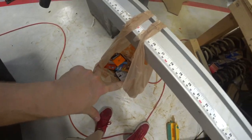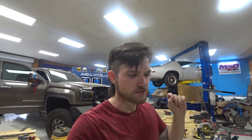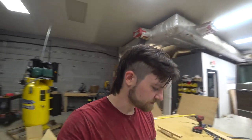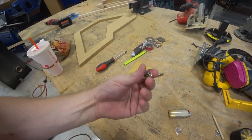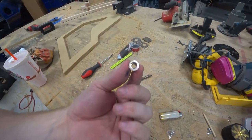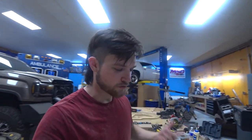There's a ton of different ways. Part of what I did was I went to Home Depot and I got a bunch of wood anchors and wood mounting stuff, so you can run metal coarse threads through the wood, but it'll also be regularly threaded. It's hard to explain, but you'll see that in the next video. Essentially, it's like a metal insert, kind of close to a rivet nut, except a little bit different design for wood. And the outside is threaded as well, so you can screw it into the wood and then still use the threads for the actual screw, so you're not wearing down the wood over and over again.